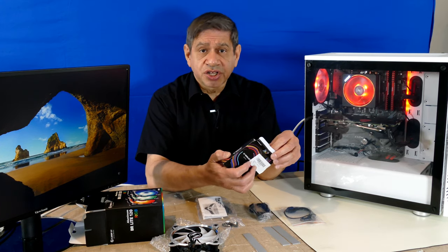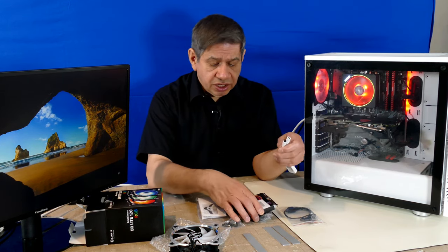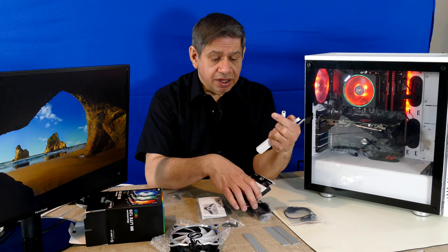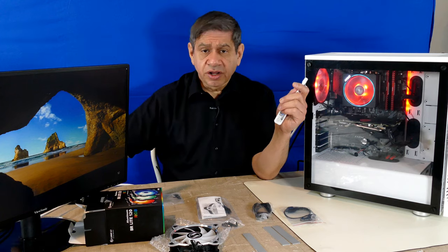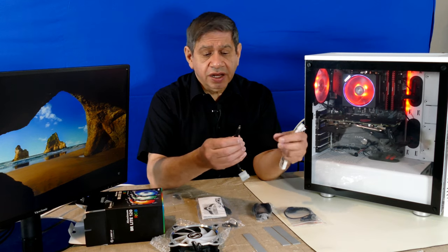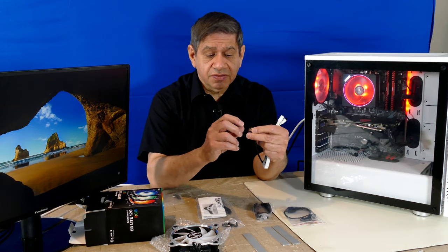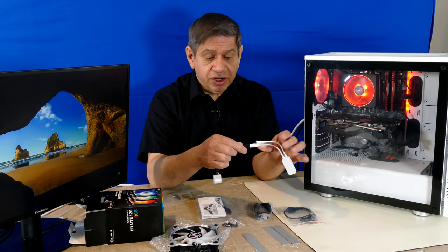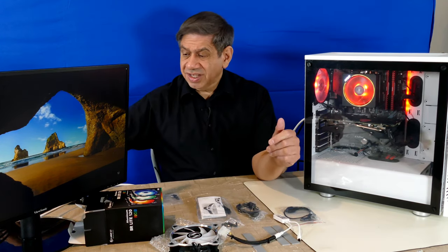In addition to that, I want to have an RGB controller since this one doesn't have one. I bought a couple of these — they're really cheap, about $10 on Amazon — and I actually have another one on order because I like them a lot. They are Wi-Fi controlled RGB controllers and also have the option of using a remote control, which I've shown in other videos. In order to make this work, I took a four-pin male Molex connector and connected it to a regular 2.5mm power connector — standard polarities, outside is negative, inside is positive. I've already tested this and it works.